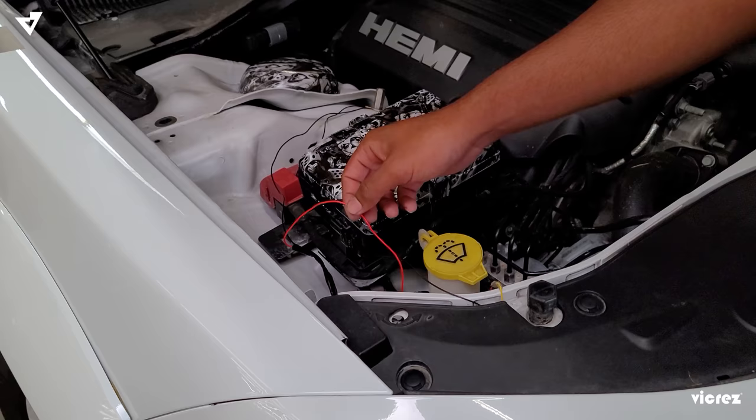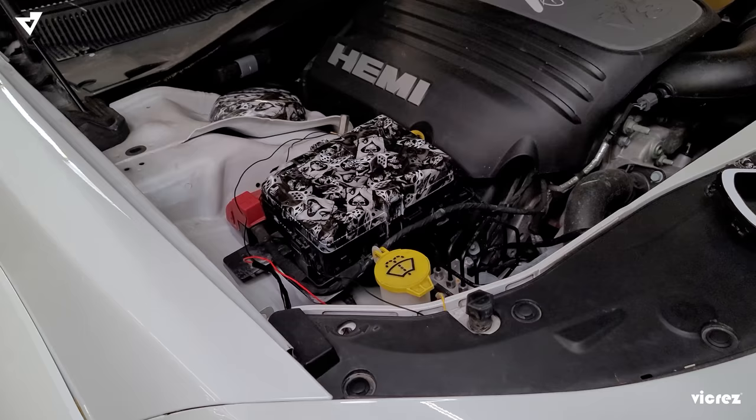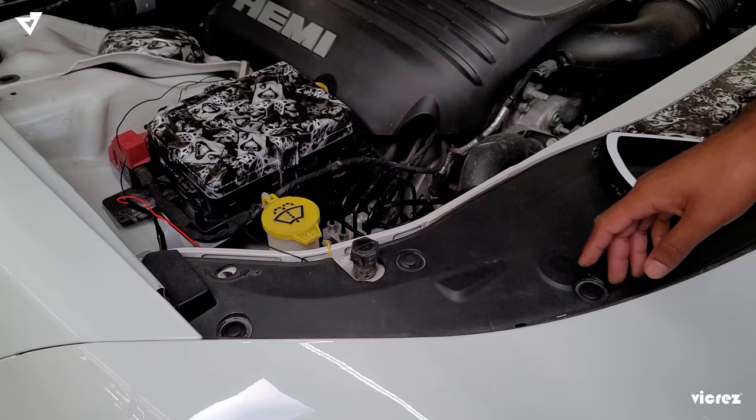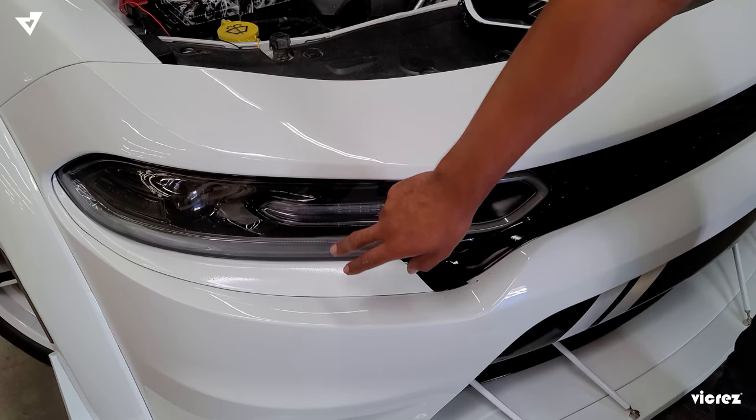For this side, for the hot wire, you're going to want to connect it to the white and orange, which is going to be the side marker. So whenever your side marker is on, your snorkels are going to be on. Once these are connected, the last thing I did was get the yellow wire and attach it to the white and tan wire. The white and tan wire is going to allow you to turn the snorkels orange to match your normal amber lights whenever you signal or use your emergency lights.